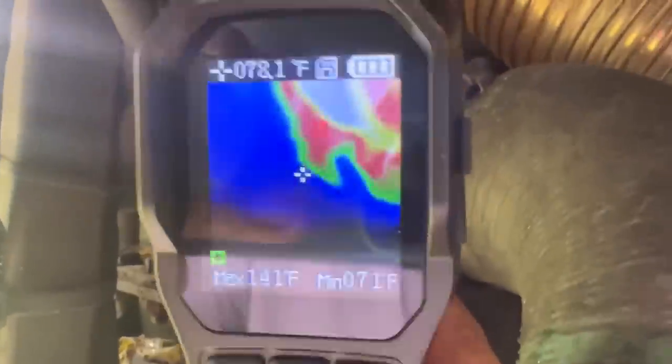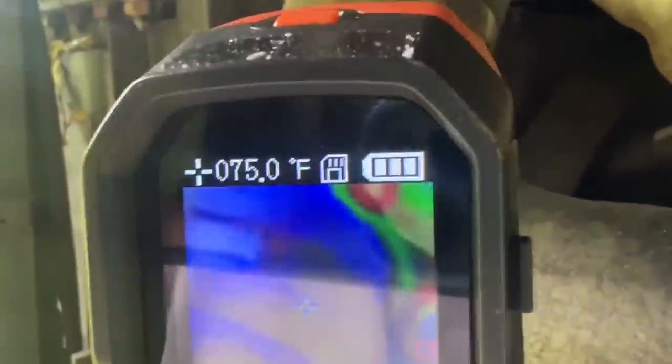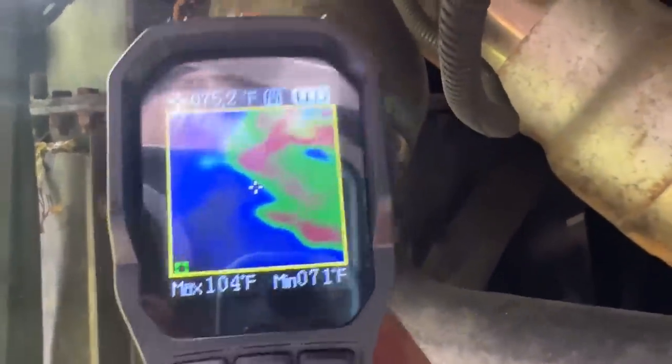And then the radiator is not showing anything warm going into it at all, which, the thermostats aren't open, but even the stuff in the oil cooler should be coming up through there as it's bypassing through. So I see no temperature increase whatsoever up there coming into the radiator. That's the exhaust hose there that's lighting up. We're gonna have to get into it here, but it looks like the water pump's the place to start, which just got rebuilt.